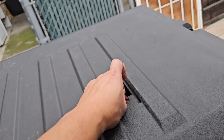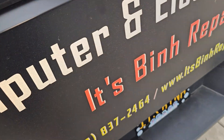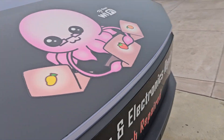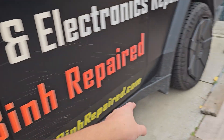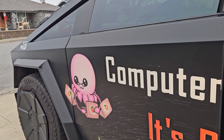You do want to test this because when I first got my truck, the wires had a kink to them and it didn't work when I was testing it. So test all these features in your Cybertruck before you depend on them. Test both sides, both passenger doors — make sure those release latches work. Again, if you lose power, that's how you get out. You're not going to be trapped. You can open all four doors and the back. The only thing you can't do is roll the tonneau cover up, but that's the least of your worries if you have no battery. Hopefully this helped you guys out.